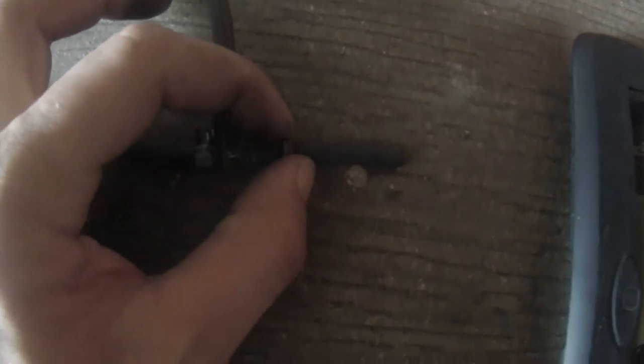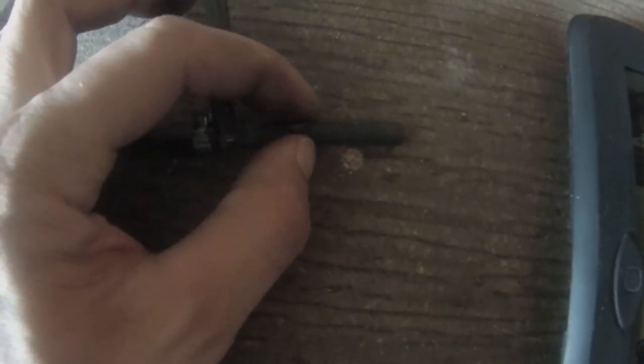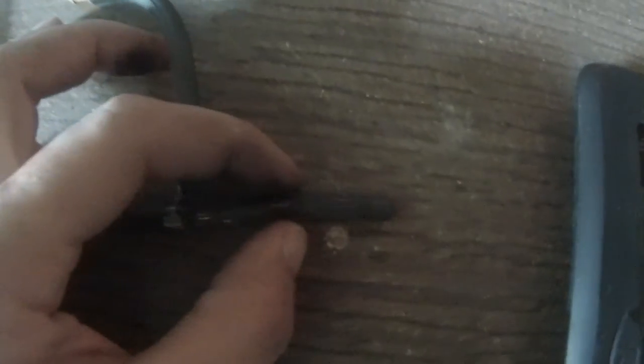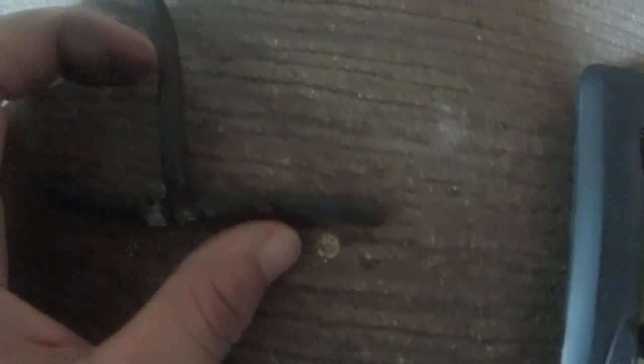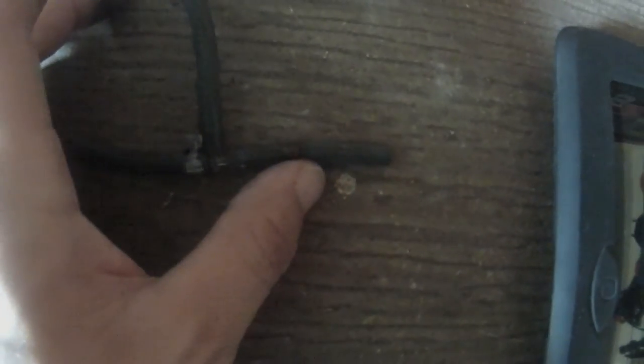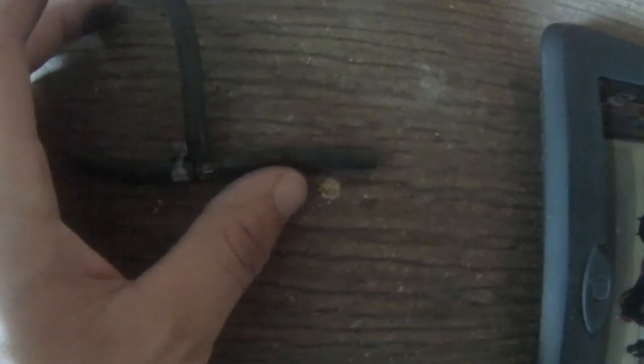inside like that. You want to make sure that you can shine a flashlight in there and that it is perfectly inside there straight like that, so you can see through it, because it needs to breathe through it. And that's what'll give you your stock boost. So if you're not hitting stock boost, or if you're at the wastegate boost, then this could be a problem